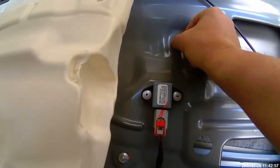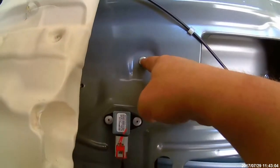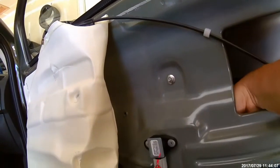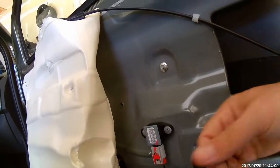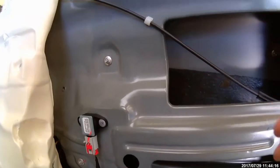I want to get back in there and look at those parts. It's a 10-millimeter bolt — I'm going to finger-tighten it on and then go about that tight with the others. I think it's this plastic bracket that gives people problems, but mine looks intact. That plastic on either side can become brittle and crack and allow the window to slide out of place, but mine functions fine. So I'm thinking it really was just that this bolt had rattled loose and needed to be tightened. I don't hear anything else out of order, so I'm going to put it back together.